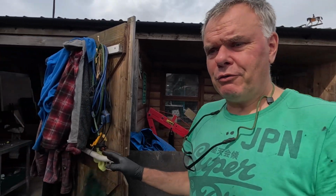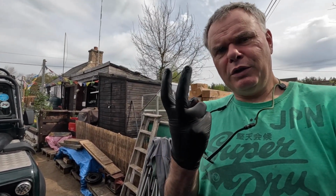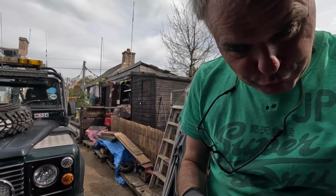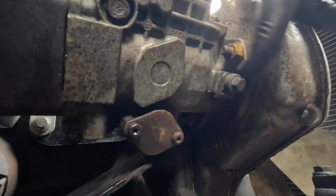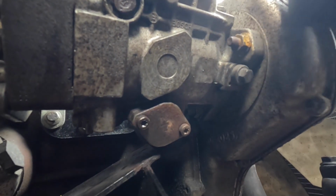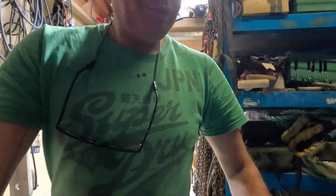So, in order to lock the fuel injection pump so that I can remove it and it won't rotate, I have to withdraw slightly a bolt, take off a really thick sort of Y-shaped washer, and then screw the bolt back in again. And the bolt goes in further when I screw it back in, and that locks the shaft, okay? And I can show you it on Bruce's engine, hopefully. Bit of upside down camera work. So there's the bolt, and there's the thick plate. So unscrew that a little bit, the plate drops out, screw the bolt back in. And because I will have already preset the timing and locked the timing on the engine, that will just work.